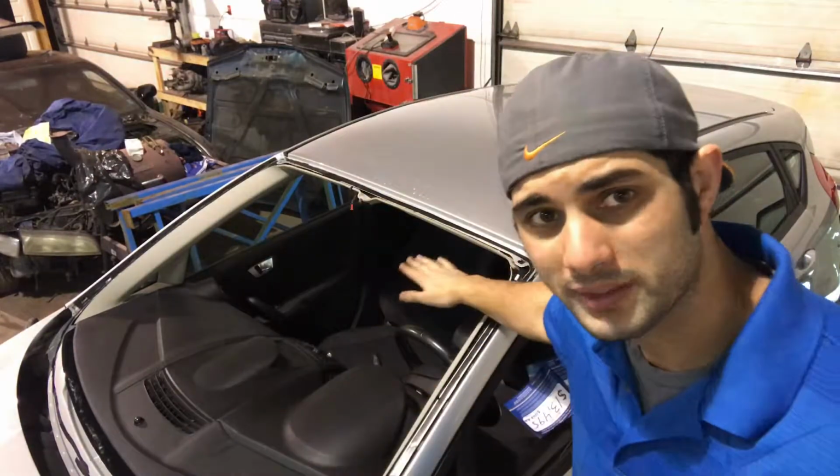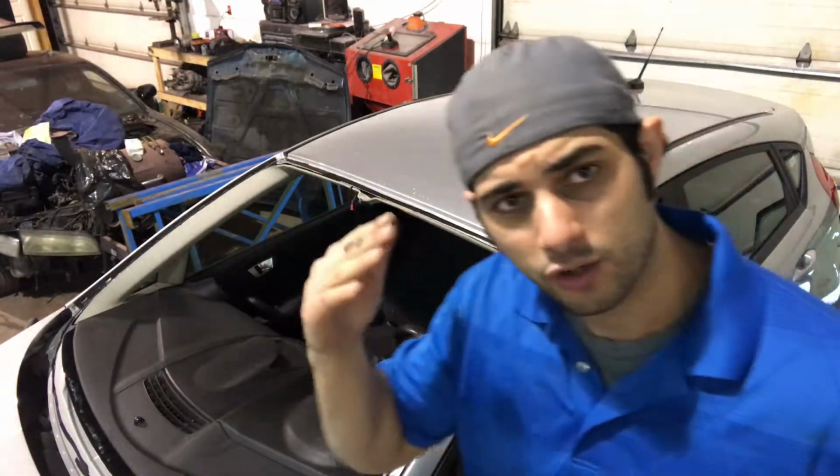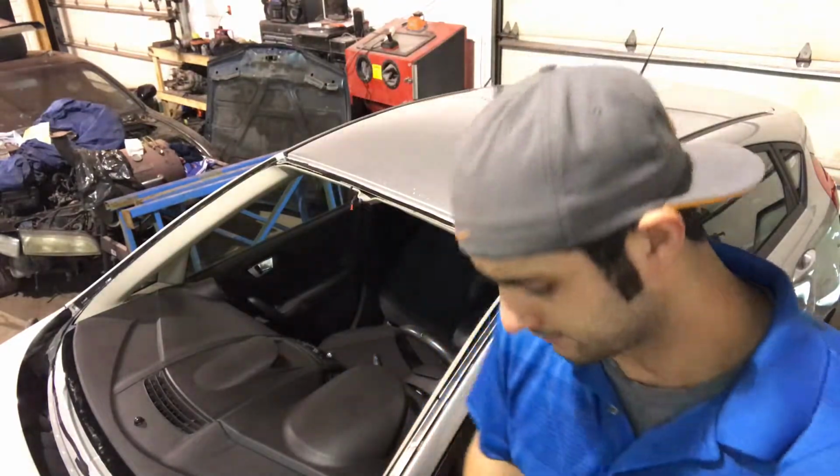And take notes of the windshield level before you remove it. So like some of them will be sitting recessed down, some of them will be sitting flush with the roof. Take a note, then that way you'll know where to cut this notch and where to place your new one. It's these little things that make the big difference.